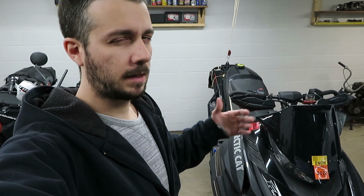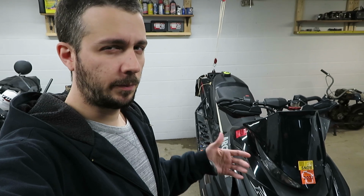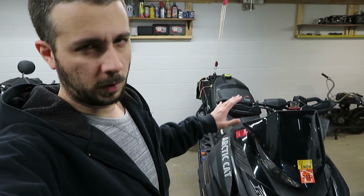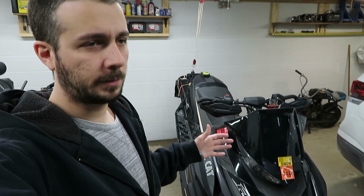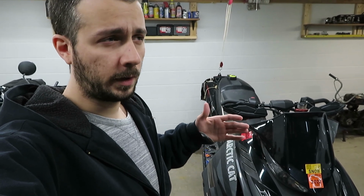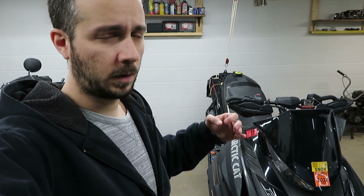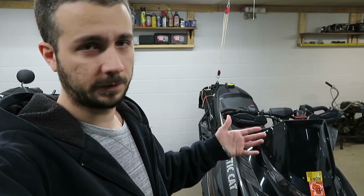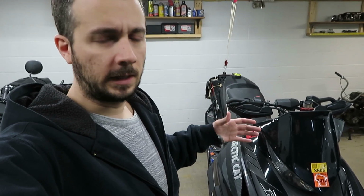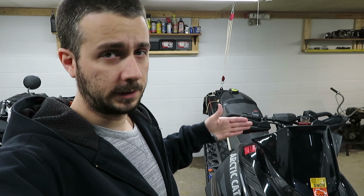I'm also kind of thinking that maybe one of my springs has been replaced at some point and the other one is still old, so I think that might have something to do with the tension. But regardless, I would say probably the most important thing is that you start a little bit looser than you think it should be, and then slowly tighten it up to the point where you're just beyond where the track wants to ratchet when you do those wide open throttle pulls in as fresh of powdery snow as you can find.